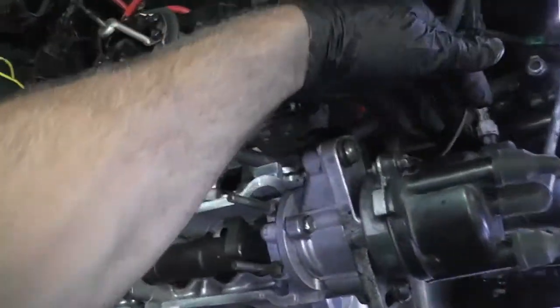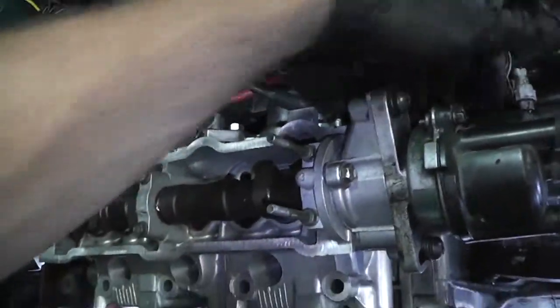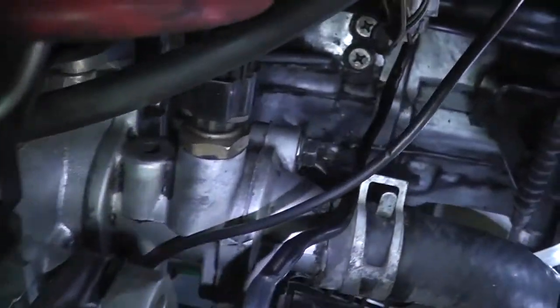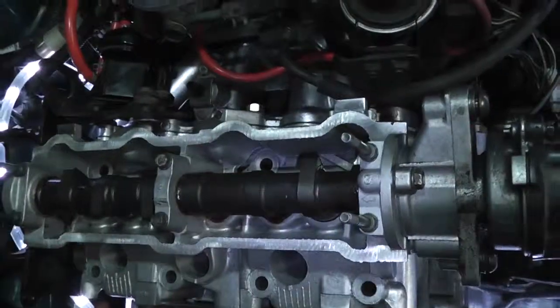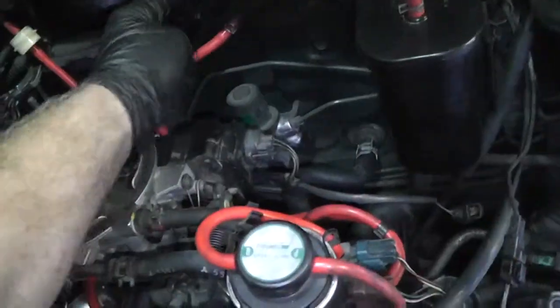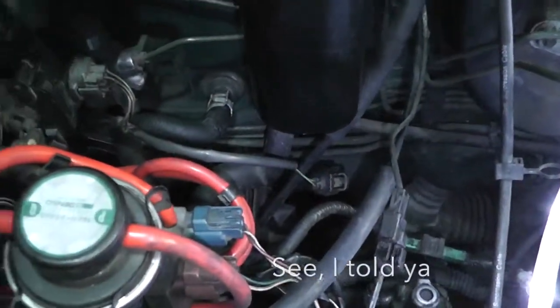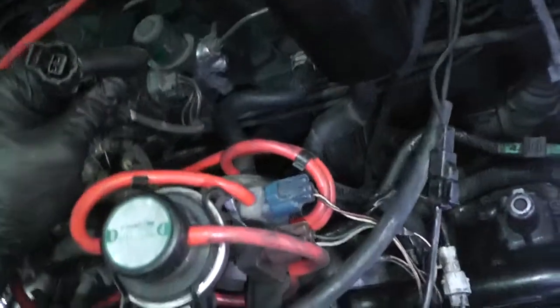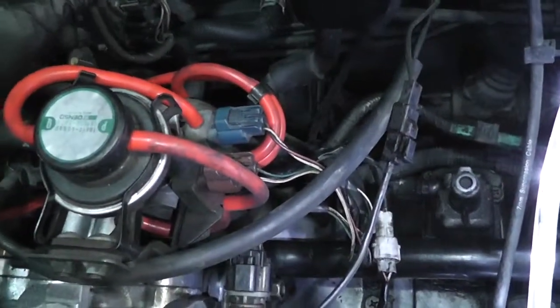We're getting close. Here's where we're at. The ground wire for the distributor, which I couldn't find before, actually goes on the bolt that's opposite of this, so down below. You can see where it goes, right there. That's where that's supposed to go. I had to look that one up on the internet. While I was on the internet, I confirmed, but I can still drop tools all over the place. No, I confirmed that this blue wire and this gray wire do nothing. They're not meant to go anywhere. Still, this guy is a mystery to me. So he doesn't go either of those places.